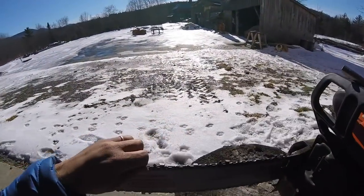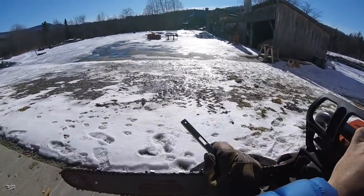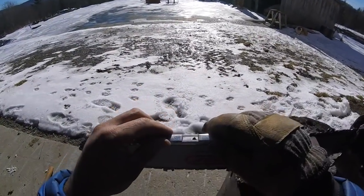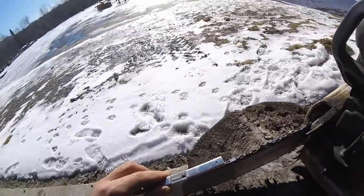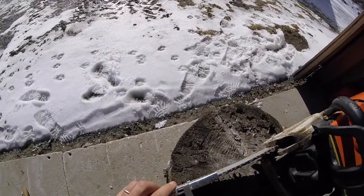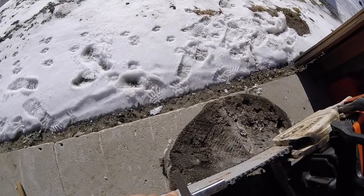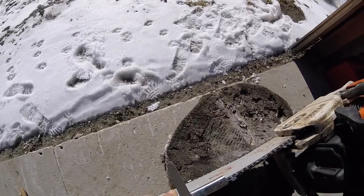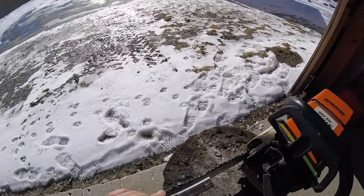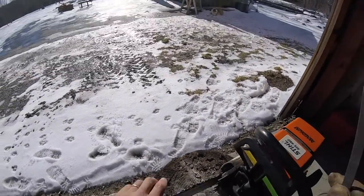That's nice. I think I went big last time with the cutting on this. So those are looking pretty good. And that's the side I actually took more off of. So this works just like this, by the way. You hold it on. Exposes the proper amount of that depth tooth, and you just are cutting that as these two stop it. And then some people in softwood will take another extra pass or two like that.